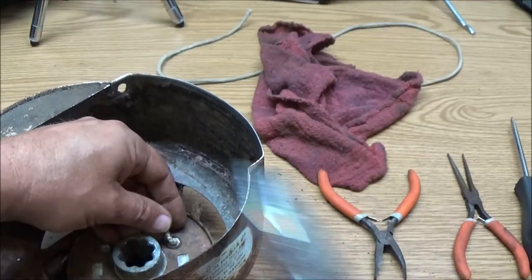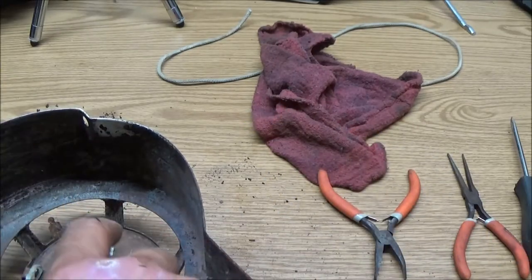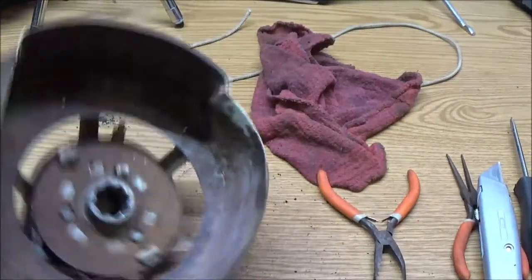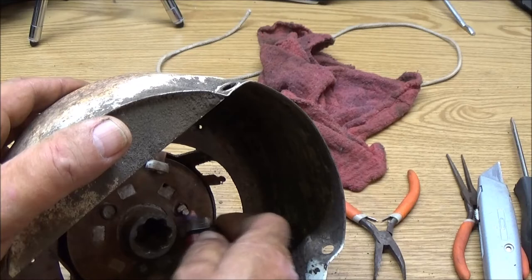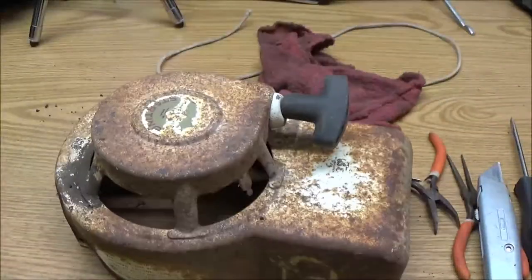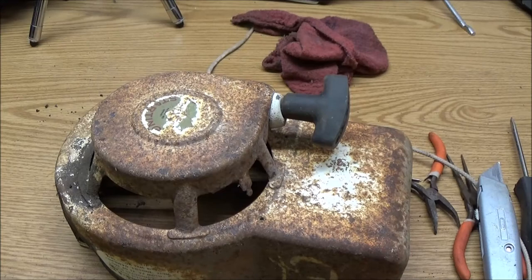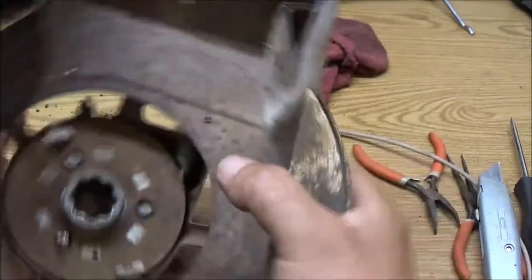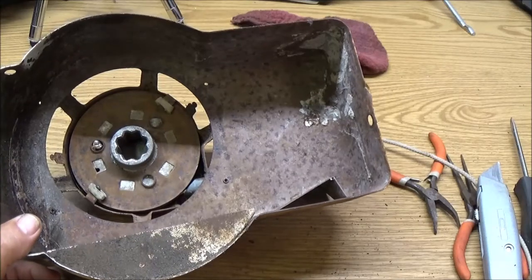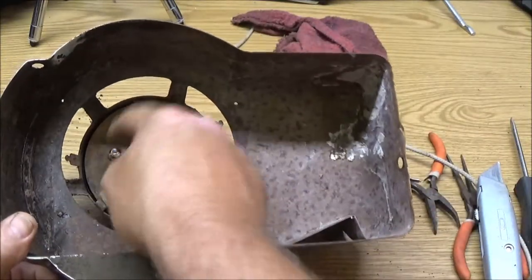There we go. I'm going to try to cut that little piece off. I hate using a knife on this stuff — I'm afraid I'm going to cut myself. Now we're just going to take our lighter and kind of mold it there a little bit. Restringing a Briggs and Stratton — Tecumseh may be a little different but it's all on the same basis. These Briggs and Stratton, that's how you do it from two horsepower on up. I'm going to tie these over twice for extra security.